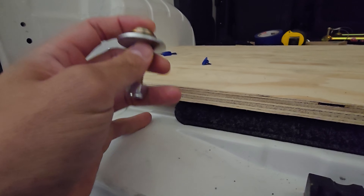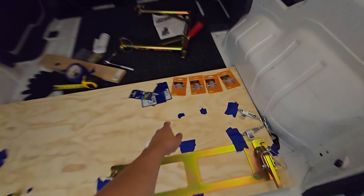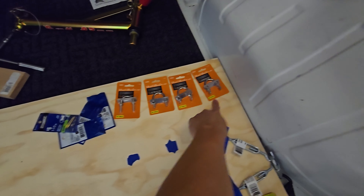So two inches would be nice to cover the whole thread of the bolt, and then maybe just recess the end of it so that it's not grinding into the floor of the van. So I have everything mocked up. The rear wheel will be right here and it's going to go straight that way — it should clear everything. Right now I'm finalizing measurements and decisions before I start drilling into this piece of wood. I'm going to be using these U-bolt things to hook the turnbuckles into it, in this location, this location, and this location. Once you tighten it, it shouldn't move — it's fixed.